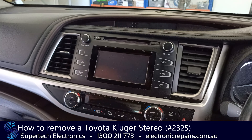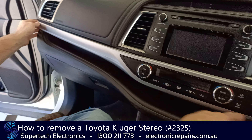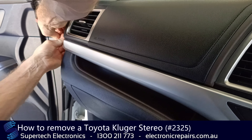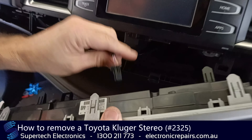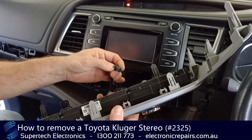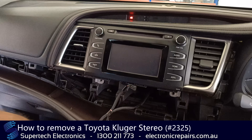Alright, let's get going. The first part we're going to remove is this plastic trim around here — that's just held in with clips. Best way to do it is to start from this end and peel it back. That will pull back and expose two cables plugged into it. You'll need to remove those by pressing the center pin and pulling it towards the front of the car. We'll put that aside for the time being.